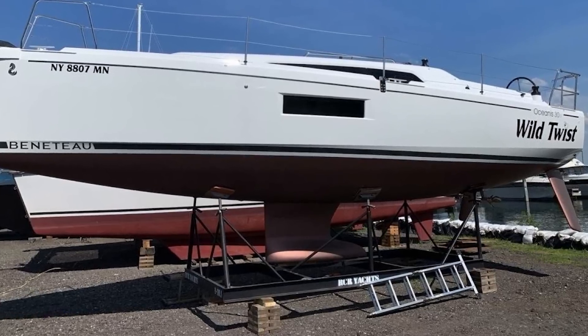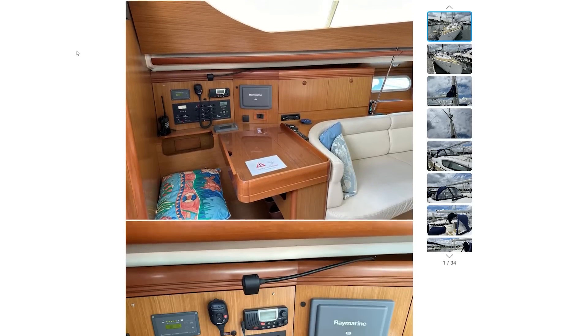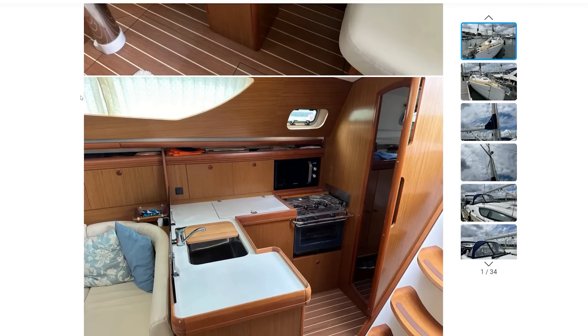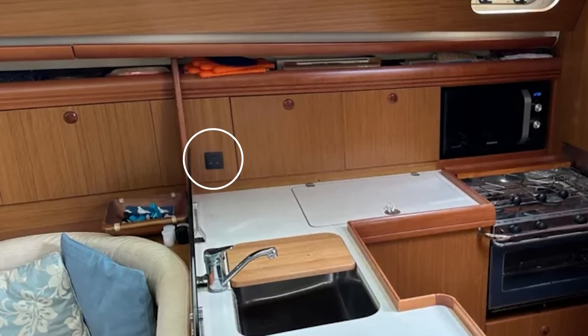On a side note, if you're boat shopping and a boat shows up in Florida that seems too good to be true and the price is too low, ask what keel it has. Often we see production boats sailed here from the Med with the seven-foot keel, priced way under market because no one wants a keel that deep around here. It would be very hard to live with on the east coast and definitely not Bahamas friendly. A little trick: look at the electrical outlets inside the boat in the pictures. Euro-style outlets run 220 volt and usually mean the boat is from Europe with that seven-foot keel. Regular 110-volt North American plugs usually mean a boat made for America with probably the five-foot keel.